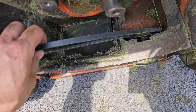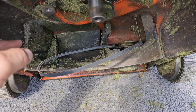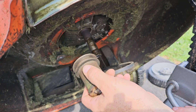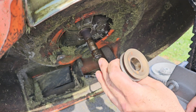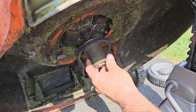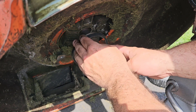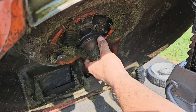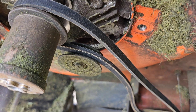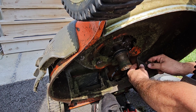So if you can't get your pulley off and it's rusted on there — these things have a lot of moisture from grass buildup — you can get it past those keepers and it will work out. We'll get the other pulley back on the shaft and then move on to the gearing system. To reinstall the belt, take the pulley back onto the shaft — hopefully yours comes off the shaft. Put the belt around the actual pulley, spin it, and you'll feel the keyway slip into place. The underside of the belt goes around the pulley and the belt is on.